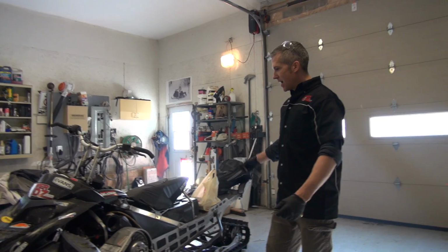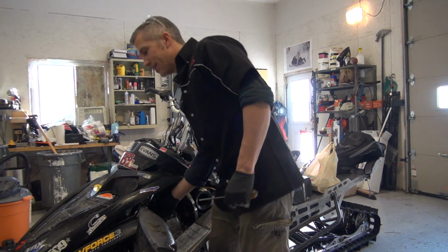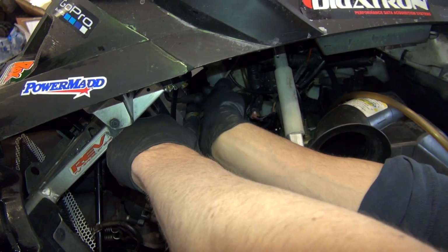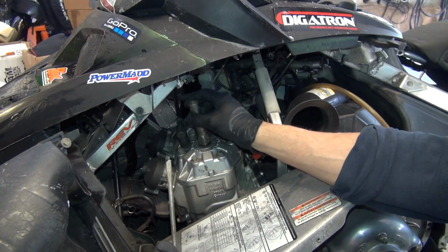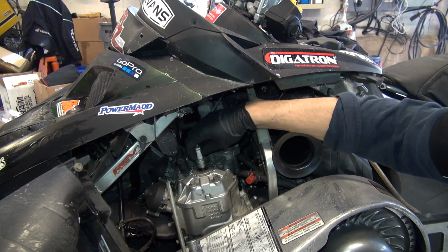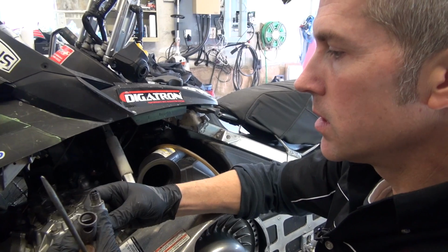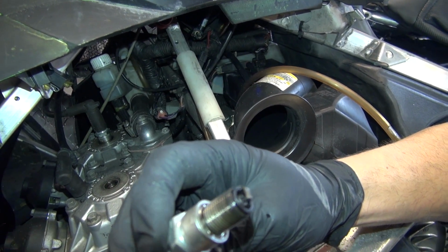But I've done a lot of riding with this in the last little while, so I'm going to check out the plugs, see how they're looking. I had the computer, ECM or the MPEM, recurved. Good God, that was tight. Had it recurved, and I'm running 32:1 Syntrax oil in it. Syntrax from Coastal Blending and Packaging, Irving Oils. Well, it's not too bad. A little wet, but I just started it up.